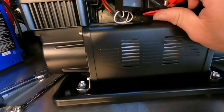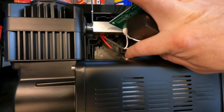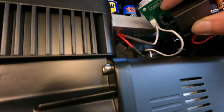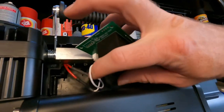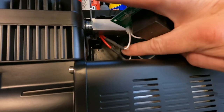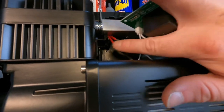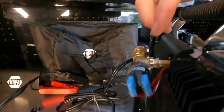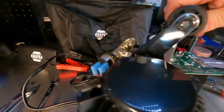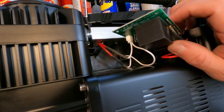This board is a little bit different than the MaxiTrack board in that you can see it's got these white wires that go to the switch out front. I made sure that I cut the correct wires. If you don't cut the correct wires, you'd have to flip the connector around where it goes into the motherboard. Look at which side is the power and which side turns off on the switch — you want to cut the wires on the power side. Once you cut those wires, just solder in two jumpers and run those to your pressure switch. I wired these up with the connectors that the pressure switch came with, pushed those on, and cut them afterwards so I knew what length I needed.